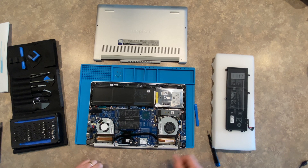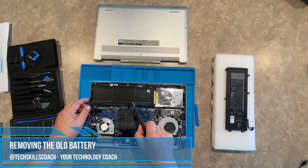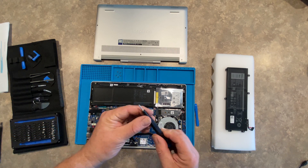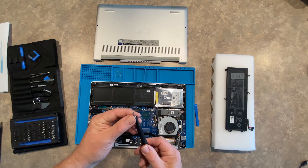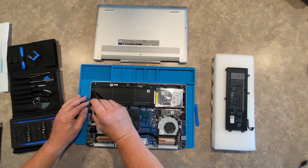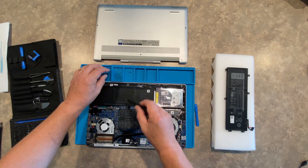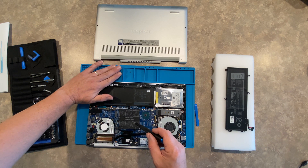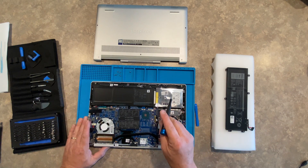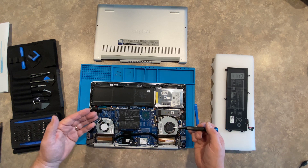Once those are off, I'm going to remove the case. There's the inside. This is the battery that we diagnosed as bad. I'm using my screwdriver with a very fine Phillips end on this. There are several small screws, and I'm going to keep these in a separate area — not with the bezel or case screws. There are times where screws will vary depending on their purpose in the chassis or on the motherboard, so there may be a different threading, size, or length.